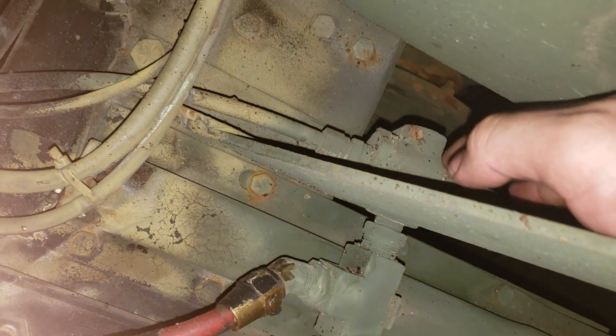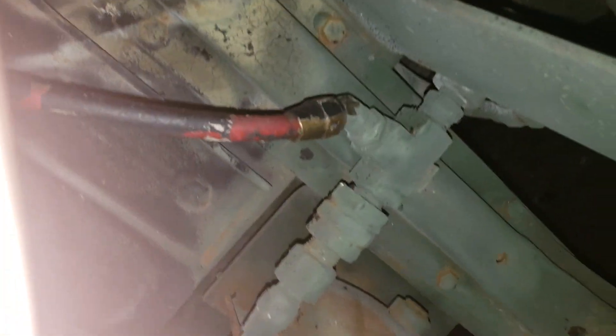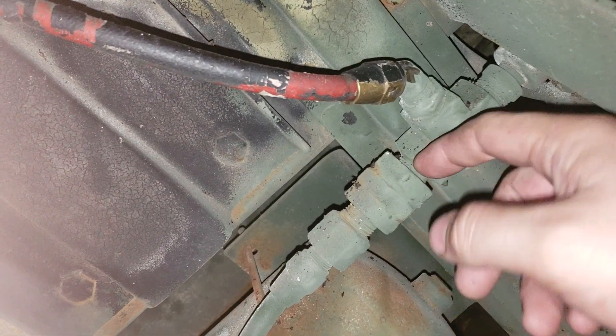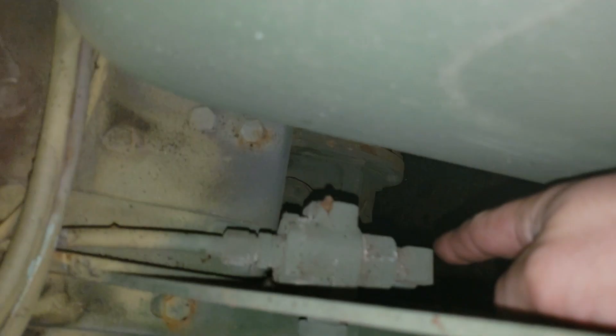You've actually got two valves. This is a KN25060 with a regular T half-inch fitting. This is a KN23000 one-way check valve - it only allows air to go one way, nothing to come back. And this is a two-way check valve.